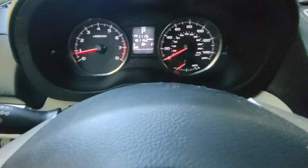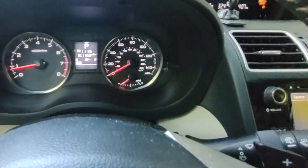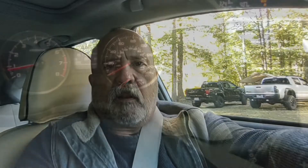We just took it for a test drive — about 7 or 8 minutes — and this is what we got: we don't have the Christmas tree anymore. Apparently that one solenoid was causing all that problem, and getting it changed solved it. It cost me less than a hundred bucks for the Dorman solenoid plus the Subaru parts. I'll put links to everything in the description. Subaru won't sell you the solenoid — they'll sell you the whole valve body, which runs about a thousand bucks. So that's an easy way to save around 900 bucks if you're inclined to do it yourself. I hope this video has been helpful. If it has, share, like, and don't forget to subscribe. Thanks for watching.